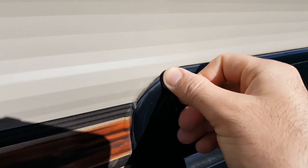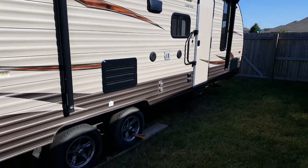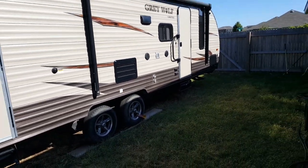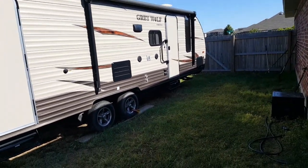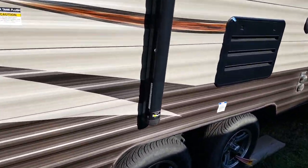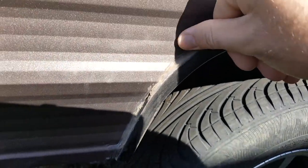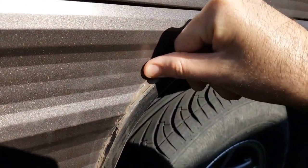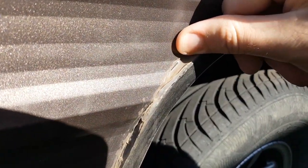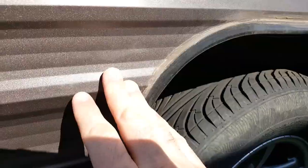So if I came over here and looked at the sealant and there's a lapse, I'll just mark it. The reason for this is if I go all the way around the camper, I don't want to try to memorize all the locations when I try to seal this. And when you're inspecting all these areas, it helps out a lot when you come up to it to actually just press on these areas. And you'll see right here, let me see if I can get the lighting just right, that there's actually a lapse here. But it's not on all this joint, it's just on this portion.